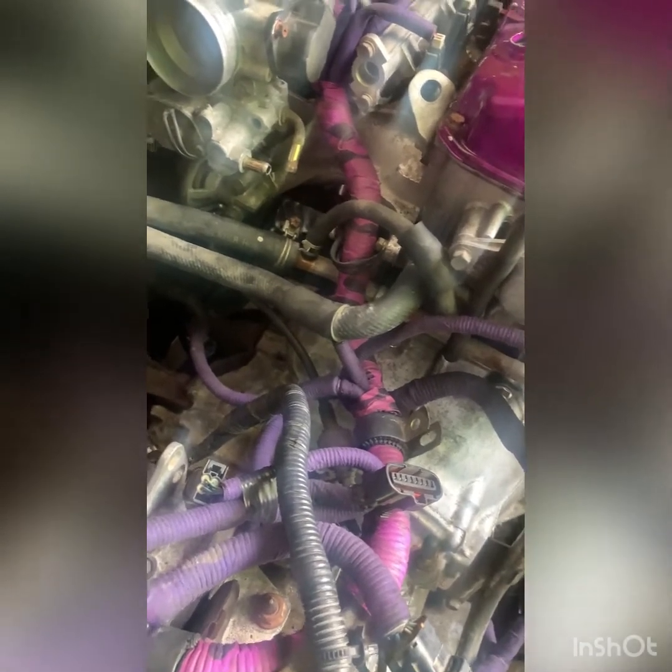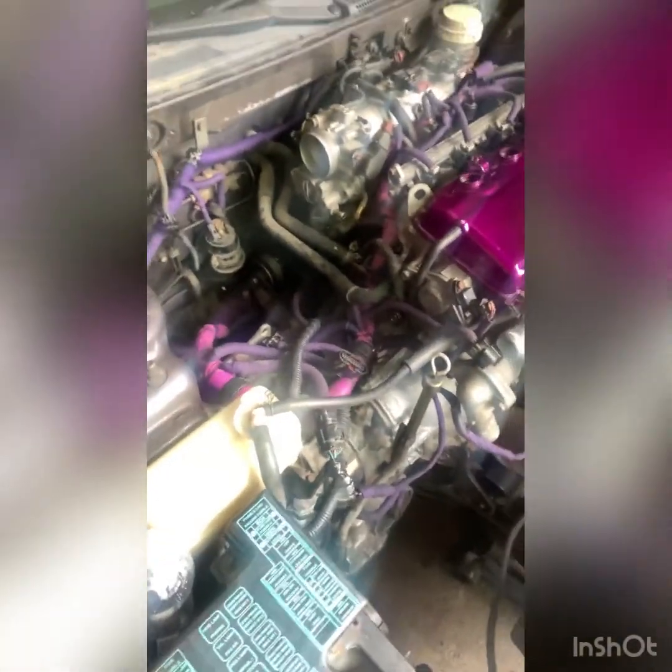I was following a YouTube video from 802 Garage, and they mentioned that the non-turbo manual and automatic share the same flex plate between the transmission and engine. But I don't see how, because when you put the top bolt on the starter it actually hits the plate. So I'm going to have to drill out the plate if I want to reuse it — I'm not taking the transmission out a third time. So yeah, that was fun.